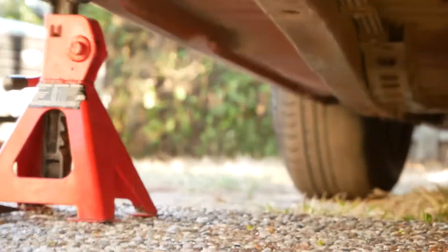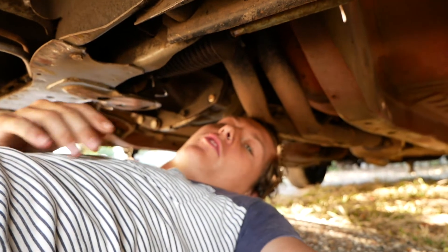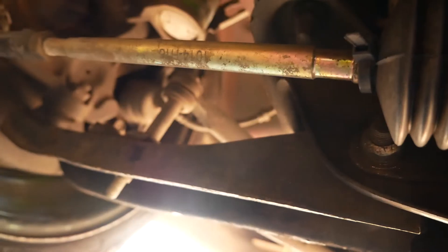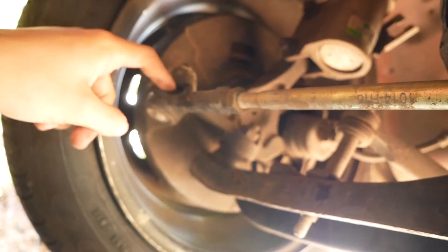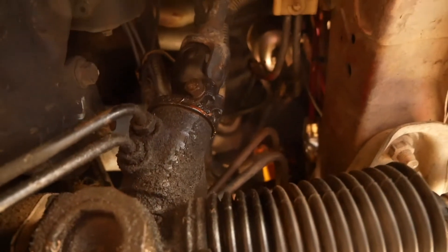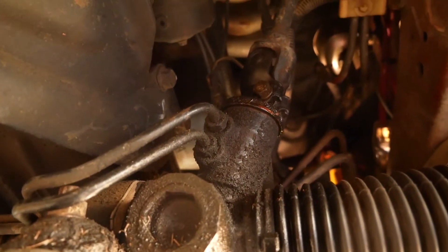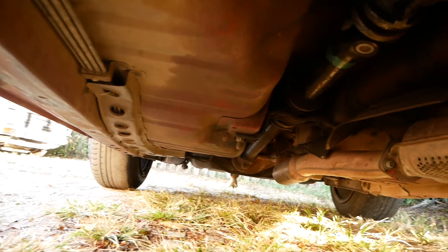Look at that rail — it's mint. There really isn't much room to move the camera around because of the mic but I've looked at all my lower control arms, tie rod and tie rod ends — they all look good. Although that one tie rod end is completely shot, I need to get a new one, but it's not bent or anything. Same with the other side. There is power steering fluid leaking out of the seal where the input shaft goes into the steering rack — it doesn't look super bad, not absolutely horrendous. Apart from that, everything looks really good under here surprisingly. Everything looks reasonably straight. The exhaust has taken a beating. The plan is to crawl under with the tape measure and do a couple of measurements — I'm not sure exactly what I'm measuring for but if something's different I'll figure it out. Something's definitely different, but hopefully nothing's bent.